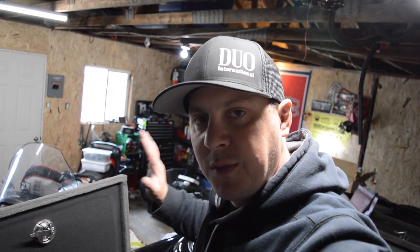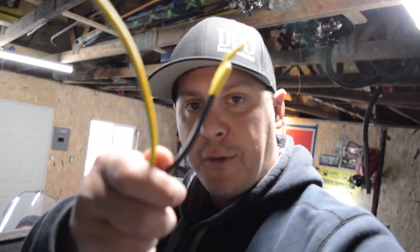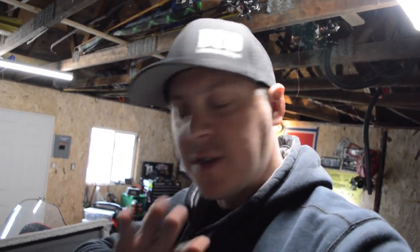I've run my cables from the main battery, and this is the important part: you want all your electronics to run from the main battery. The reason is if you hook up your electronics to the trolling motor batteries, every time you press the pedal you're going to send interference through your fish finder. Rig it separately on the main battery — positive and negative. I ran my wires last year and you can see how big those are — those are 10-gauge wires. With 10-gauge wires there's less restricted flow of electricity to your Humminbird and less interference going through. You also want to rig those wires on the opposite side of your trolling motor wires, because your trolling motor wires will carry interference — if you put them on the same side you will have interference when running the trolling motor.